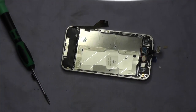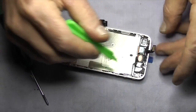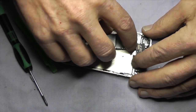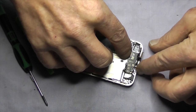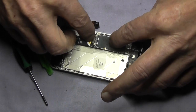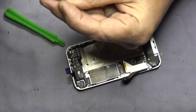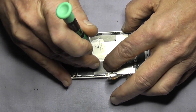With that done we can go for the logic board — care must be taken here. I'm just pushing the flex cables down because it does help to get the logic board in. We're going to feed the logic board in — we've got to get past the three connectors and then with it slightly up in the air push it forward, making sure it's seated at the top end where there's a little groove it goes into as well. It should go down flat — you shouldn't have to force this at all. Next we'll put the two screws in for the logic board: the center one and the one near the speaker box.